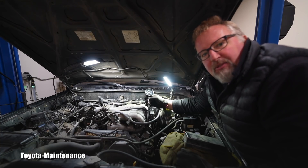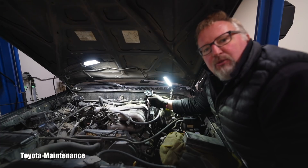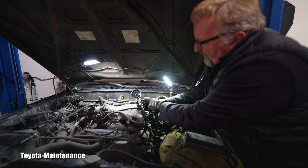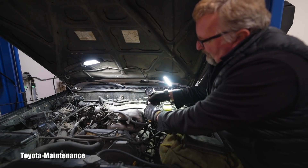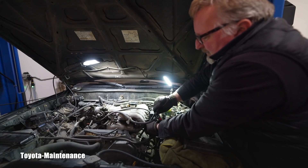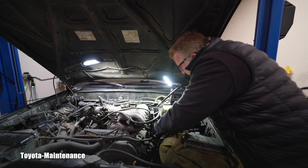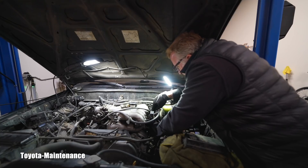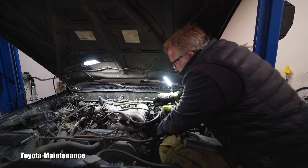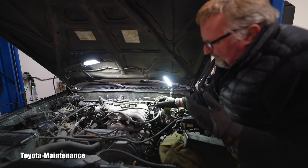And it stopped pulsing - I hope you can see it - at 220. It's exactly 220 PSI. I'm going to write it down. I release the pressure, then disconnect the gauge. The reason I disconnect it is that it's easier to manipulate this rubber extension hose and catch the thread on the bottom, especially right here where there's a bunch of stuff already since I installed everything back.